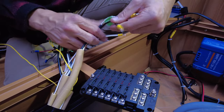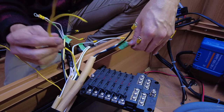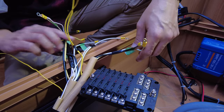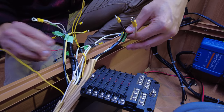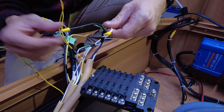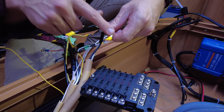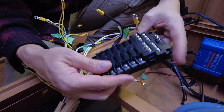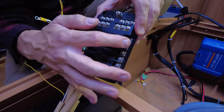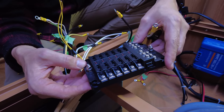Now we're ready to wire up the fuse block. I've fitted all the connectors, although I've still got a couple of wires — these yellow wires — that I'm not sure what they're for, so we'll leave them off for now. With Jayco, you can see there are all black and white wires. Instinctively you'd say black is earth and white is power, but it's the opposite — Jayco's black is the positive, the live wire, and white is the earth. So all earths go up the top of the fuse block and all positives go down the side.